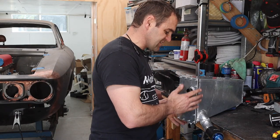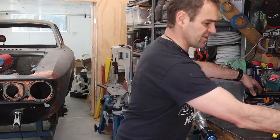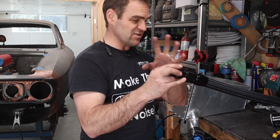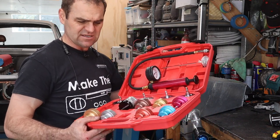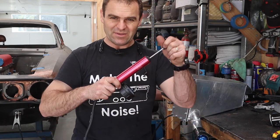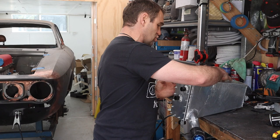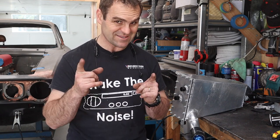I have my gasket made up for the top. I've got a bunch of Raceworks AN plugs I've put on everything all around the place, and I actually made up my Dash 20 hose — it's too long at the moment. I put a straight fitting on one end and a cap on the end of the hose as well. For pressure testing I got myself a radiator pressure tester kit — I'll put a link in the description. I'm going to use my air compressor to pump up pressure, then go around and spray all of the joins and welds to see if it makes bubbles. Bubbles mean leaks, no bubbles mean no leaks. That's the theory, so let's test it out.